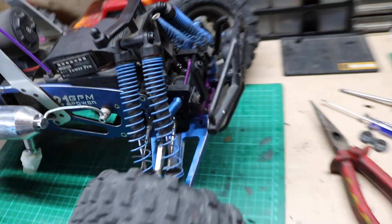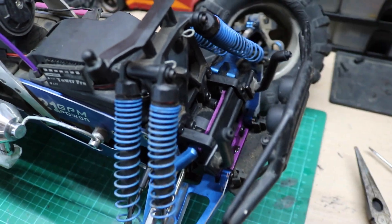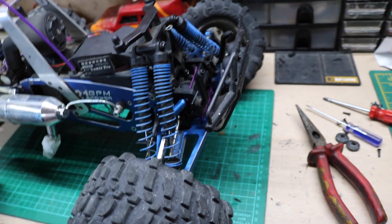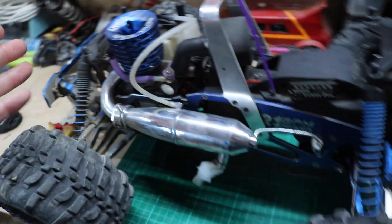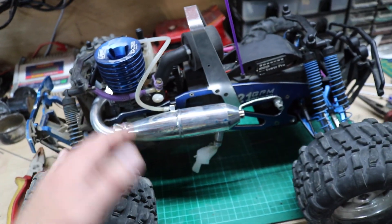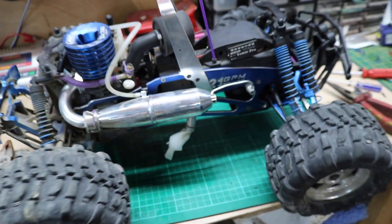She's pretty much back together. I just need to put a few more screws in the bottom. There's a little bit of an issue with that pin — I must have bent that a little bit, so I can't get it all the way in. I'm going to get a big pair of pliers and squeeze it together to get that in. But that's pretty much done — we've got the four bevel front diff. We just have to wait for the center one or the back one to break, and then I'll upgrade that as well.